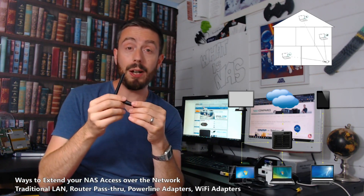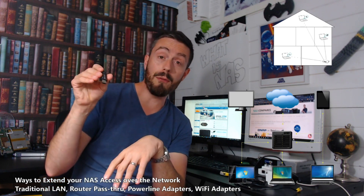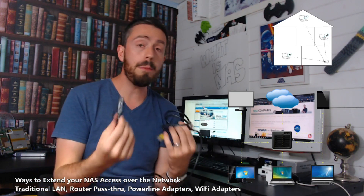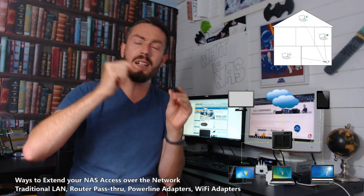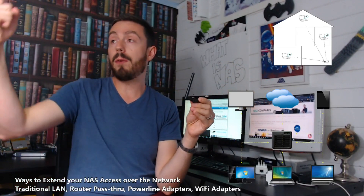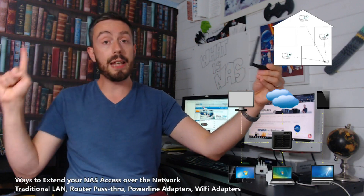Even with a good Wi-Fi adapter — they go up to 1.2 gigabits per second, though more likely you'll get 300 or 500 megabits — the coverage just isn't as good as standard LAN cables. So if you're using high-density files, maybe 4K media, this may not do the trick. But for lots of smaller files it will definitely work. Once your NAS is on the Wi-Fi network, it will appear on the same range as your phone, tablet, iPad, smart TV — they can all communicate. Remember, this isn't about connecting one device directly to your NAS. Think of a network as a circle: all devices have to be on it so they can communicate with each other. It's about them both being on the same network — the same railway, if you will.